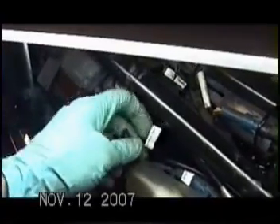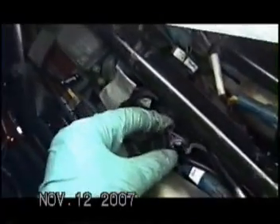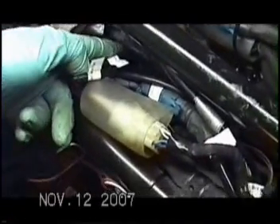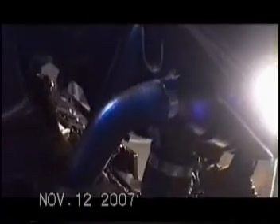I put a label with my Brother label printer, and I made sure to put dielectric grease in here too. Having a label on each end makes it really simple and clear. It also helped me to see which direction the wire was tucked. I tightened this up and put a tiny bit of grease around there so the hose slides on nicely. I made sure that it's a smooth run and that it's not hitting anything — better off routing it naturally the way it wants to go.